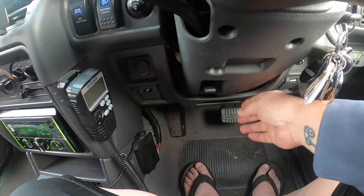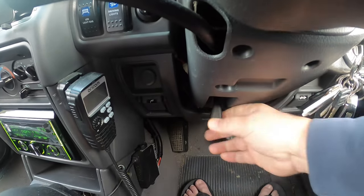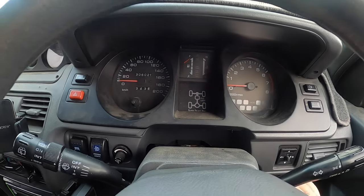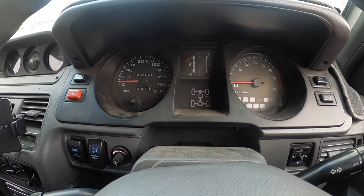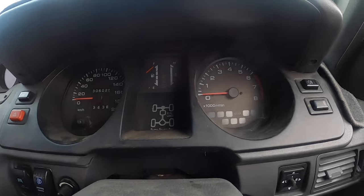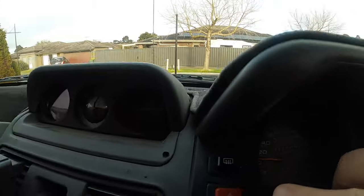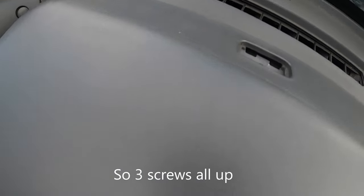There's a little lever down here - just find it, there it is. I leave the steering wheel all the way to the bottom position, and then I usually just get the wiper stalk and the indicator stalk out of the way to give me a bit of clearance when pulling it out. Now there's a couple of screws - there's one either side of the cluster, one just right there and another one just over in here.